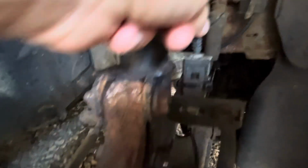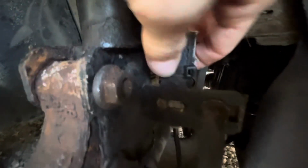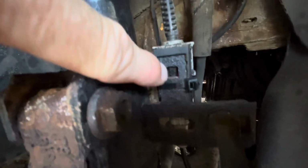The only other thing I wanted to mention on the video that was a pain in the backside is these cables. These are so difficult to get off without breaking them when it's all rusty and crusty like mine is. So I ended up breaking them both on both sides. So that's attached with a tie wrap, and that's the only way I could do it, unfortunately, because once you snap them off, there's no other way of holding them back on. So nice and solid, nice and secure. It's because there's that little tab inside there. You're supposed to be able to just press in that little tab and then it slides off.